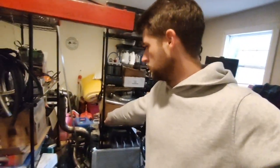So I'm going to change the rods out in this thing, and I'm going to order some heads. I found some decent heads that I've heard good things about from a couple of different engine builders, and they don't have freeze plugs in them like these factory heads do, and they've got a little bit thicker deck surface on them, so hopefully it'll keep a gasket in better, and I can just keep this thing between 900 to 1,000 horsepower, have it be very reliable, and hopefully I can drive it for a while like that and keep a motor in it and not have to keep pulling these out.